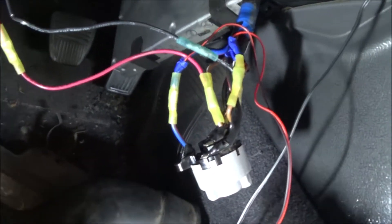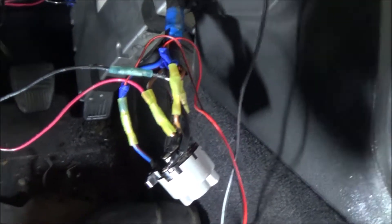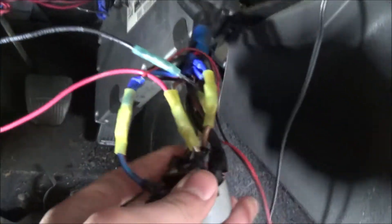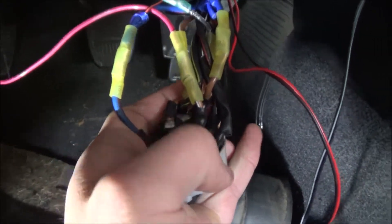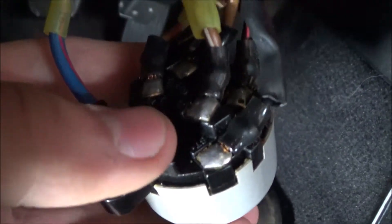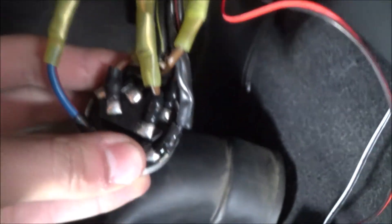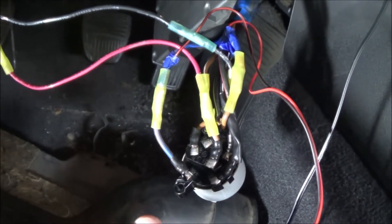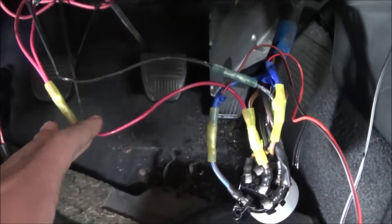I'm going to pull off the back of this key fob right here — it's just one screw. Now, this part just goes up here and then comes back down. There are a lot of wires coming off the end, but they're just sending signals, so that's why we're tapping into them to get the correct signal for each part. This red wire right here goes to the on position, and if you'll see, it goes to right where my thumb is tapping. It is the IG2. On the back they have little labels, and IG2 is where this one goes. You just have to look for this brown wire as well. I tested these all with a multimeter — I'm going to try to save you that time by showing you. This one turns on when the key is in the on position.